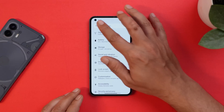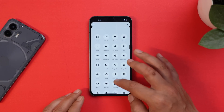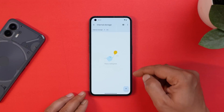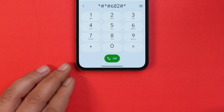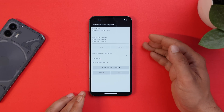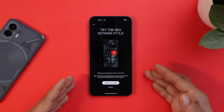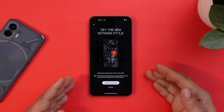I'm hoping the exact similar build will be rolled out via OTA, and the version should be 2.2.2. If you still want to install it, the process is simple: download the file, place it inside internal storage in a folder called 'ota'. Then dial *#*#682#*#* to open the Nothing Offline Updater, select the file, and install it. Again, it's a leaked file — don't flash it on your primary phone. Once installation completes, you'll see a message saying 'Try the new Nothing style.'